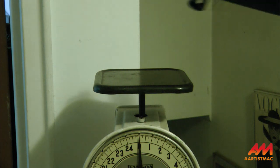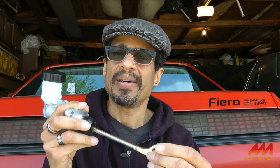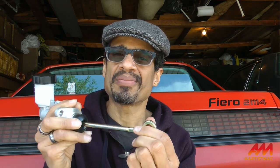All of this agony for me and other manual Fiero owners could have been prevented if Pontiac had just used a steel clutch pedal assembly. I mean, how much weight were they saving with aluminum? The steel one is only two pounds — on a 2,500 pound car, that's nothing. As for the banjo — that's what they call the end of the rod of the master cylinder — it moves, it swivels, so that should make the job a little bit easier.